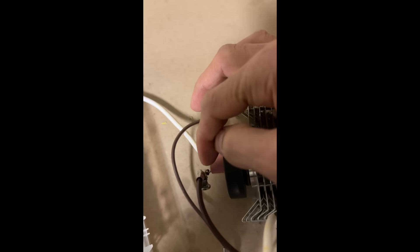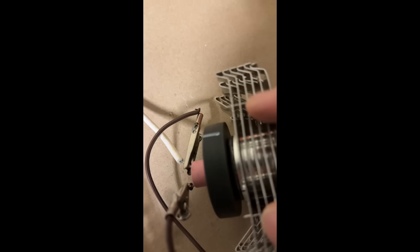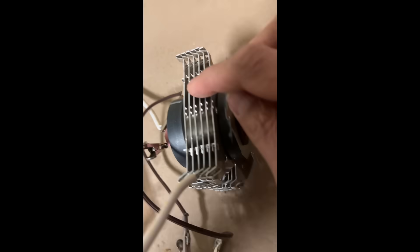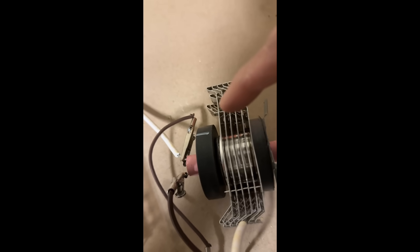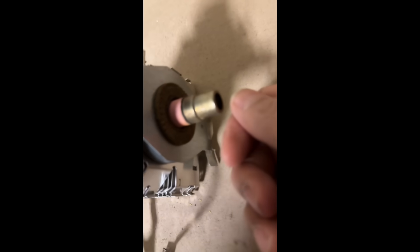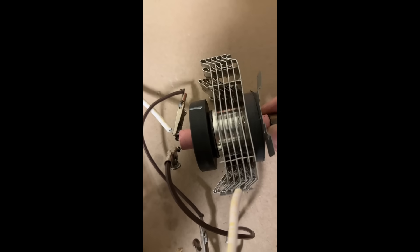In order to run these you have to put a certain voltage across the filament, usually about three to five volts, to turn the filament on. The filament is part of the cathode. There's a hard vacuum in this device and the metal casing of the device is positively charged. So electrons fly off the heated cathode and get into little cavities inside this device and generate microwaves when they start resonating. The two magnets on the end help to concentrate the microwaves that are formed and allow them to be directed out of the waveguides — that's basically how it gets into the oven itself. This pink stuff here is beryllium oxide, which is very toxic to breathe in, but it acts as a good material for transmitting the microwaves and not getting too hot.